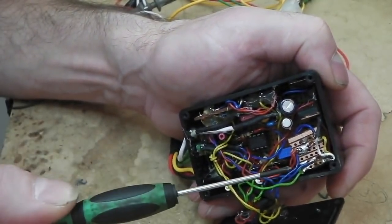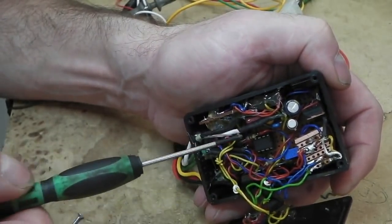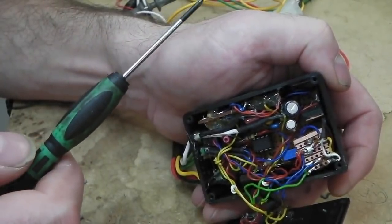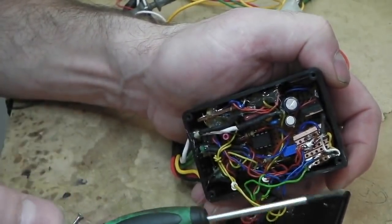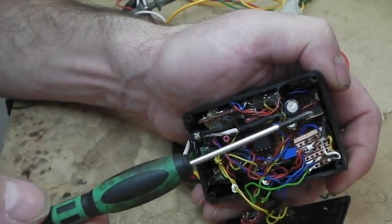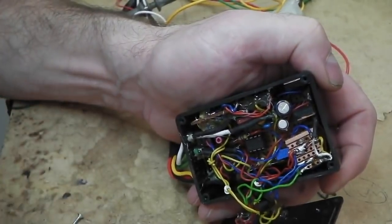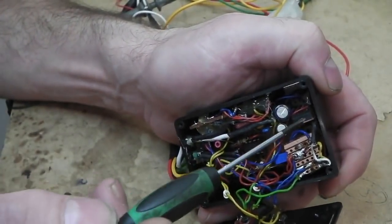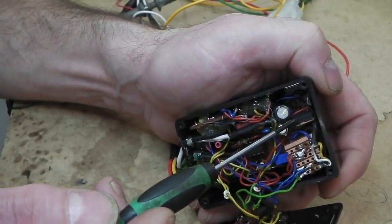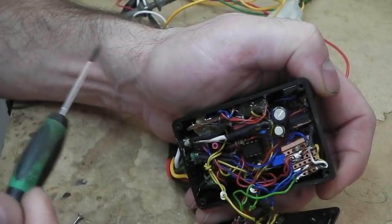And you can set it to run on 5 volts, you can set it to run on 9 volts, you can set it to run on 12 volts. They're the three types of off-the-shelf voltage regulator you can buy. 7805, 7809, 7812 for positive regs, because you can get negative ones, which are denoted 79 series. But anyway, that's a 9 volt reg, so 12 volts goes into it on this side, and 9 volts comes out bang steady on that side, has a ground pin in the middle.